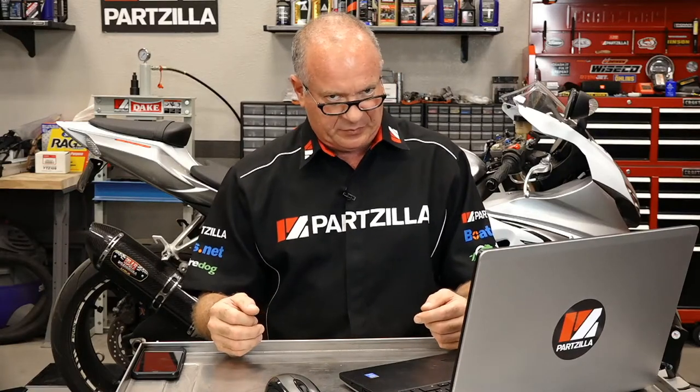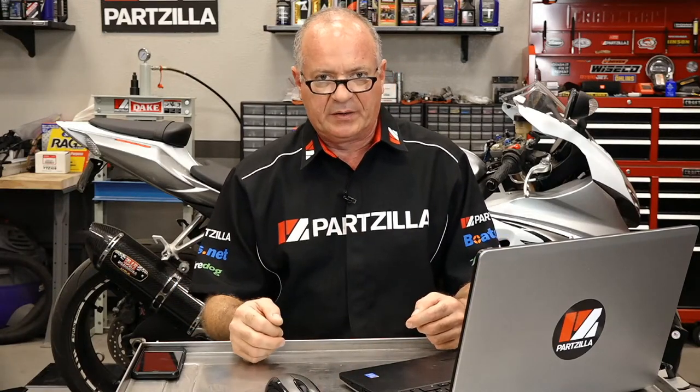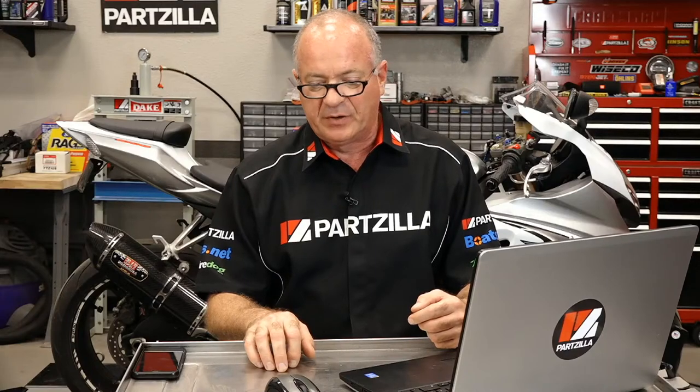All right, this is an interesting one. Jay is asking me, 2015, what is the maintenance of an oil cooler? How often to flush? You know, I don't think it's ever really been discussed as to when you should actually flush out an oil cooler, but I'm a fan of that, especially on a sports bike where you typically go through clutches quicker, because let's face it, the oil that's going through your engine is also getting thrown around those clutch plates, which are wearing at a pretty rapid pace in most cases.